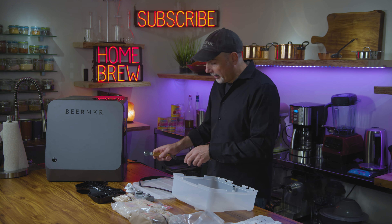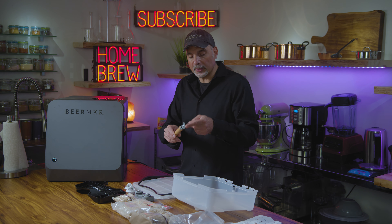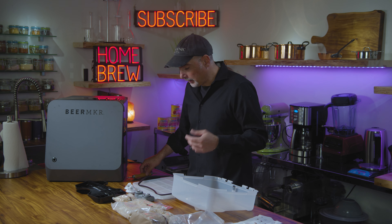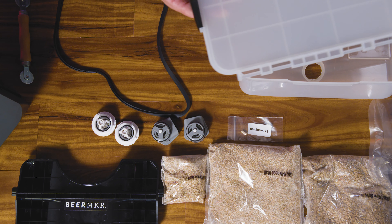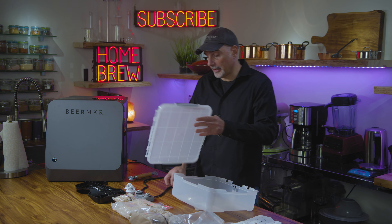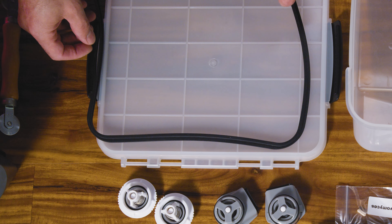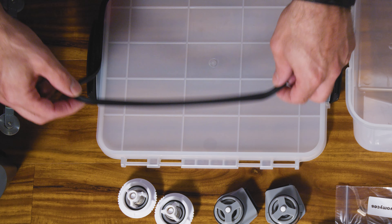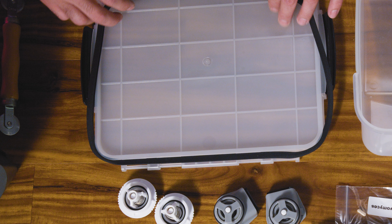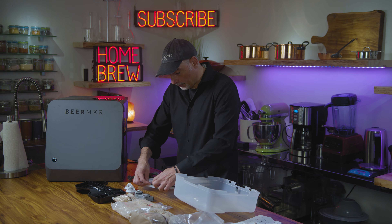They tell you with clarity how to install this rubber gasket back onto the lid. They recommend using this device here — it's actually used to put the gasket around screen doors. You can use a credit card; you don't need to purchase this device. The top of the lid has the latches going only up in one direction, so we're going to flip this upside down, and the hinge is going to be on the top. This gasket has a step in it — that step should be facing towards your counter, so the lip, the wide part, should be facing up towards you. Just get it into place by making it go around the top lip of that lid. Press it into place with your fingers as a starting point.